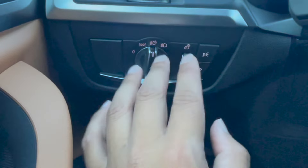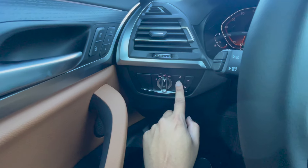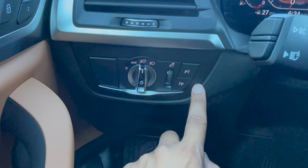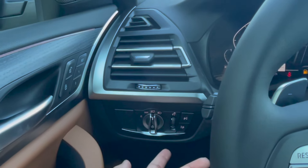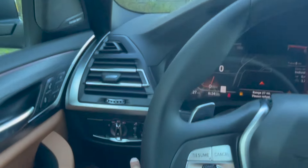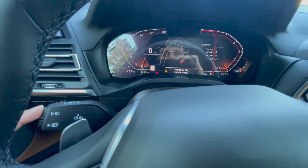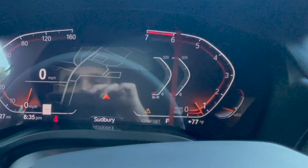We have our lighting controls right here. The easiest way is to set it to the headlight with the A on it — that stands for Auto, so just leave it there. This scrolling knob controls the brightness on your screen, which you can see when it gets dark enough and your headlights are on. Many BMWs also have these buttons here — these are simply park lights. The right one is the park light for the right taillight and the left one is for the left taillight. If you're parked in a really dark spot for around half an hour, keeping one of the park lights on helps vehicles traveling behind you see that you're parked there.